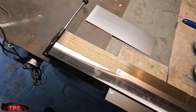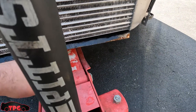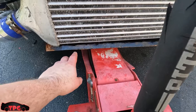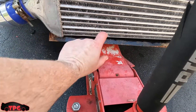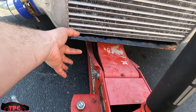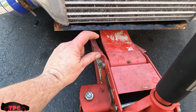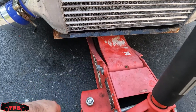When I initially put this piece on, it was just a piece of steel sticking out below the bottom and it got bent up. The back of the intercooler just sits on this curve — you can stick a finger underneath but only barely, so we're not getting much airflow. I'm going to change this — instead of having it curl down forward toward the bottom lip of the bumper, I'm going to have it stick straight down at a 45-degree angle going up to the core support. It'll stick out just a little bit below the bumper to scoop air going under the vehicle and shoot it up into the radiator and AC core stack.